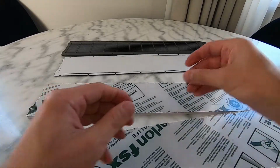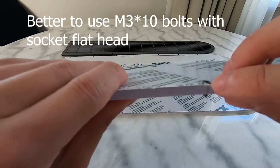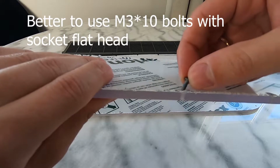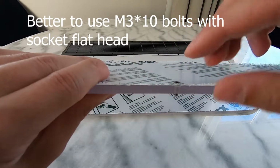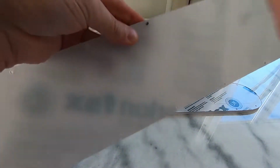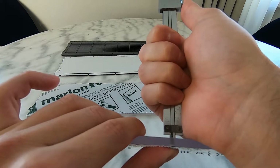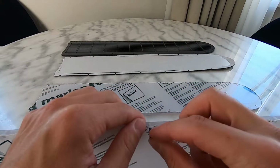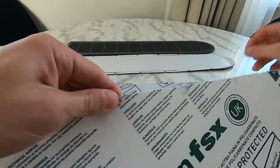And here is, for example, a bolt from my M365. If I put it from this part, it will be hidden a bit, not a lot, but it's not meant to be like this. Of course, ideally it's needed to buy a special bolt for this, but even with original bolts there are a few millimeters from this side, which can be even enough. It's 2.5 millimeters. So even with the original bolt it kind of can be used, but I would not prefer that. Even so, it is possible easily.